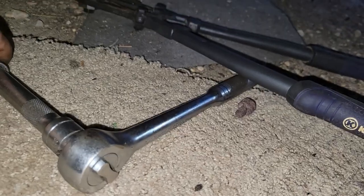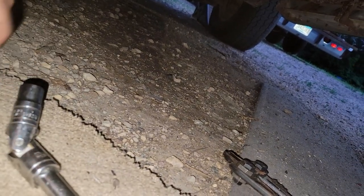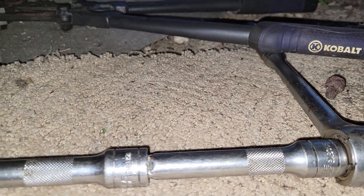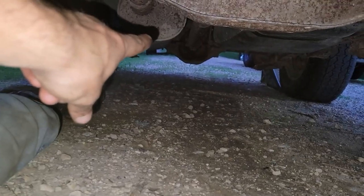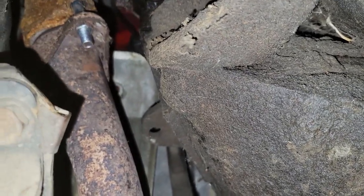All right, we're all bolted in. I was able to get up there with this guy right here. A half inch with two extensions on it, then a swivel joint on the end, because you just barely need to swivel to get in there. And it's a 14, not a 13. Those bolts are anyway. So let's go see if it starts. And sounds slightly quieter. That guy's still a problem, but it was really loud because this flange was off. The bolts were all rotted off.